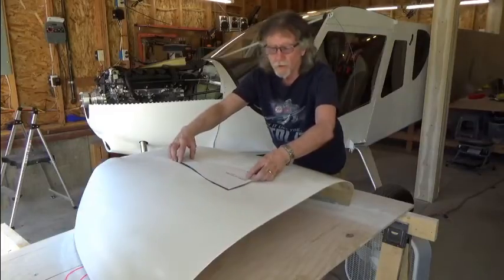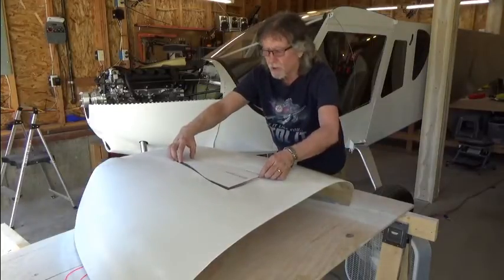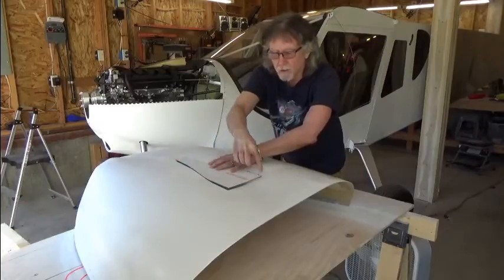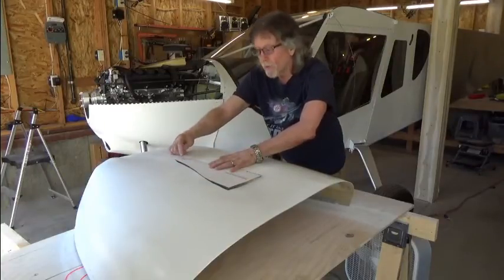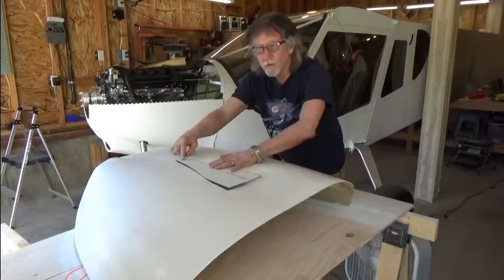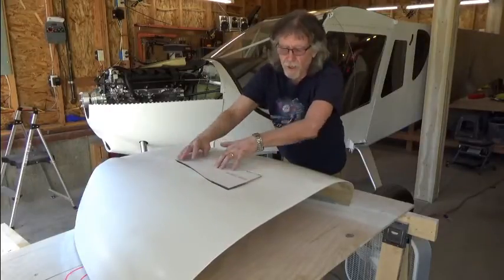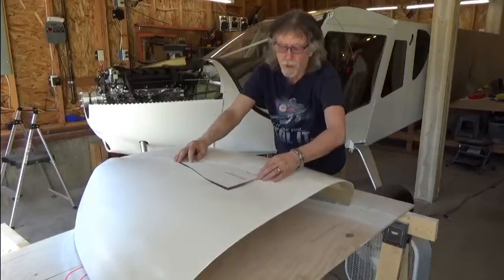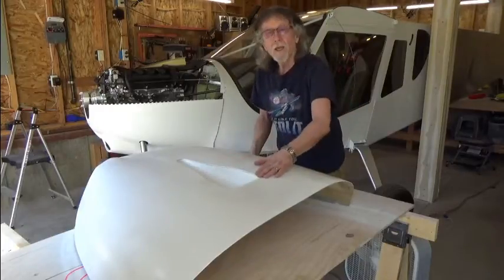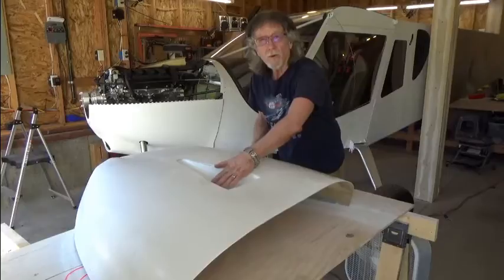Apply the template to your cowling. Once you find this edge, draw that line, position your template on it, and trace out the shape. Then drill a pilot hole and use the appropriate size hole saw to cut the hole out. With a diamond-bladed skill saw you can cut the straight lines, and when I used my Dremel cutter it just pops right out, leaving you with the perfect hole.